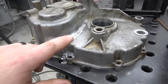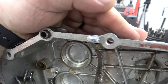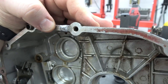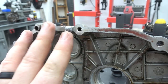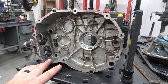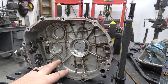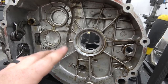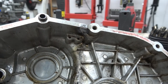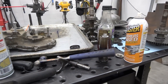I think this is going to be honestly stronger than it was before. The other reason I had my brother weld it is he welds aluminum every day, so it's a quick trip down here — why not have him do it and know it's as best as it can be. I'm going to polish this case, and then I need to sand this surface — I'll very lightly take a flap disc and smooth it out to match these two surfaces. I'm going to run a bead of RTV after I get everything cleaned up and grind it down to seal as best as possible. You can see it got good penetration and he capped over the weld to keep that edge strong.